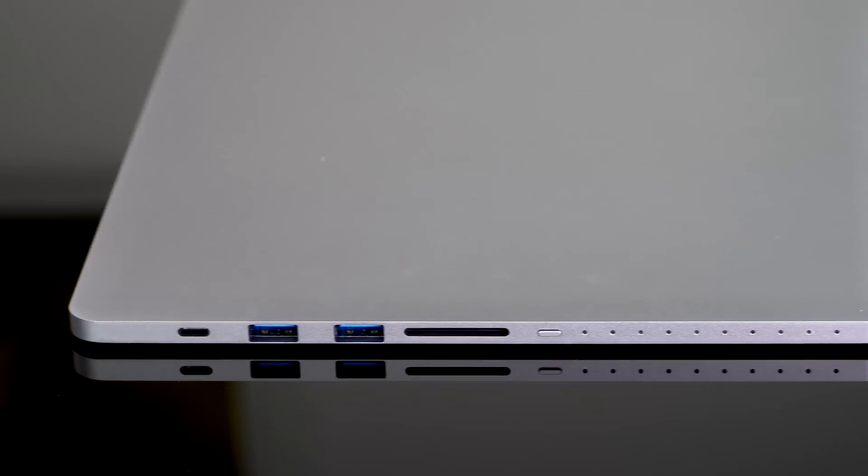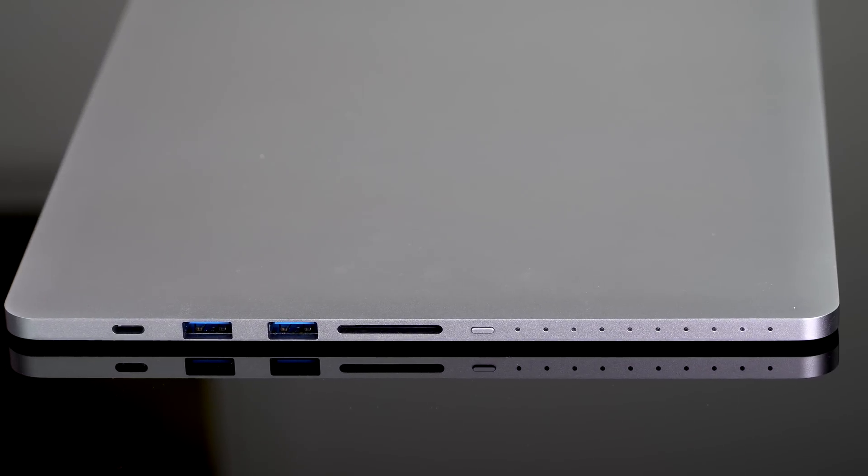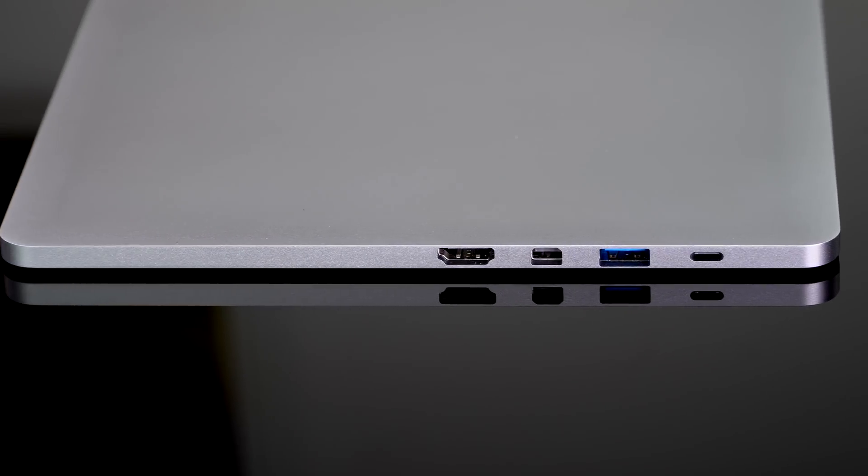You've got seven ports on here: a bunch of USB-A 3.0 ports, 4K capable at 60 hertz via HDMI 2.0 and mini DisplayPort. The right USB-C port can also drive yet another monitor at 60 hertz and 4K resolution for multi-monitor setups. It has a UHS-II SD card slot — a fast one. And the interesting thing, of course, is the SSD inside if you opt for that. You can also get it without the SSD and put your own M.2 SSD inside — technically voids your warranty, but they do give you instructions on how to do it.